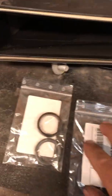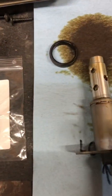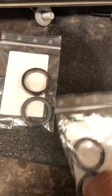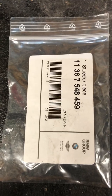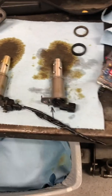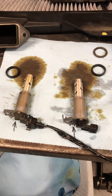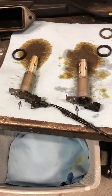It comes with a hard plastic ring which goes on first, then you put your o-ring on and torque up your bolts to specification — I'm pretty sure it's around 9 or 10 Newton-meters, not very much. There's the part number — this is a 2008 328i. We just wanted to give you guys a little insight on how to clean these things out better. I'll try to post another video once we're all done with the car and let you guys know how it ran and if it took care of the problem.